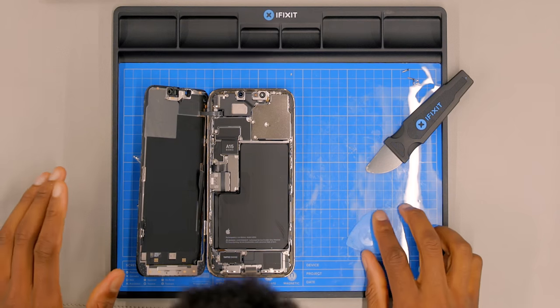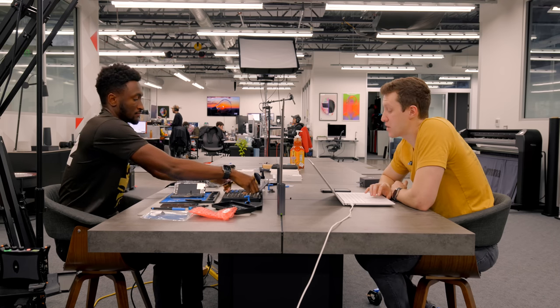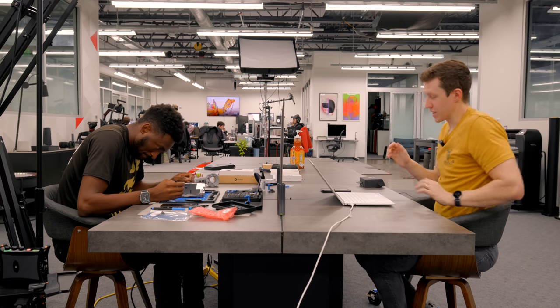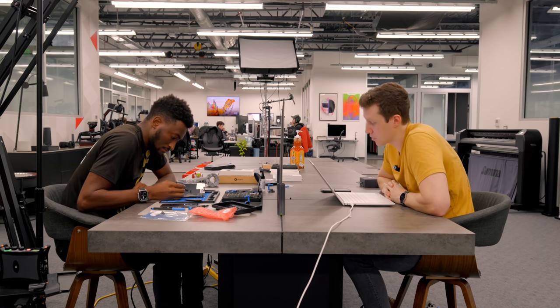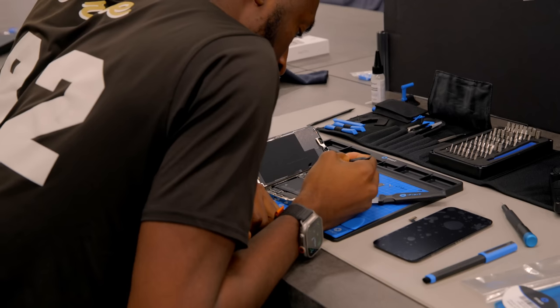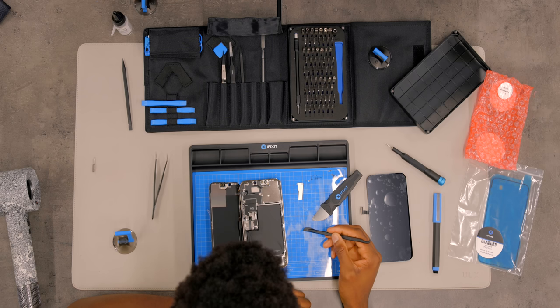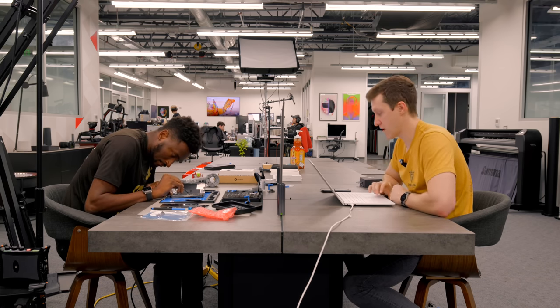Finally it's open like a book and you can see the insides really well. Using a Y000 screwdriver, remove the three screws on the middle ribbon cable. Take off that piece of metal — it's the battery connector cover. Then disconnect the battery: there's a ribbon cable tucked into the battery in the corner near the bottom screw — pop it. Using the same approach, pop the larger ribbon cable connected to the display, which is under the chip. There should be a piece of metal on top — it popped.